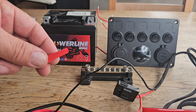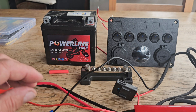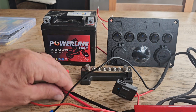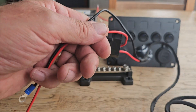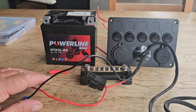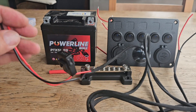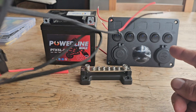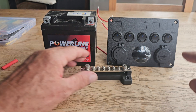These are crimpers and what they call shrink wrap pads. I've also got a couple of cables I've connected up - I'm going to show you exactly what I'm doing and how I'm doing it. I've got an extra long cable here which we'll pretend is going to a device that we're going to wire up from one of the switches. I've also got an inline fuse on this, and we've also got inline fuses on the switch panel. Some switch panels come with them, some don't, so you want to check that out.